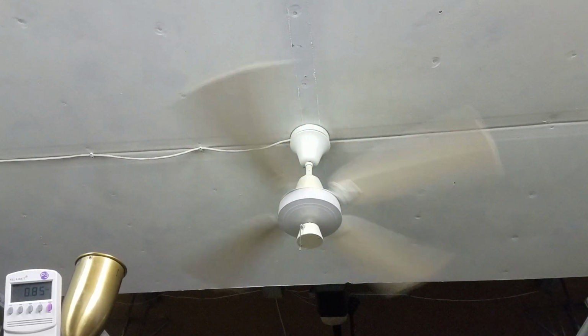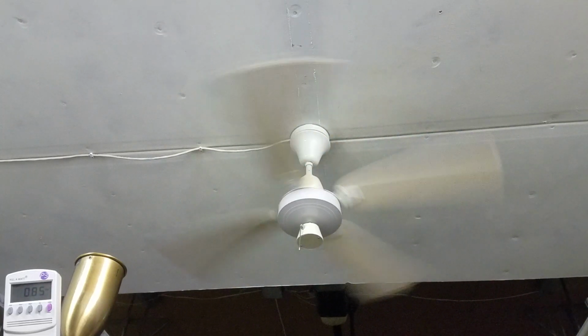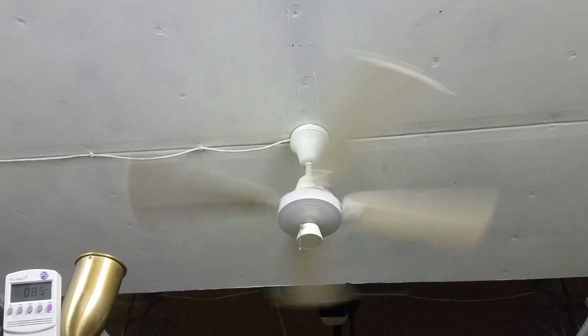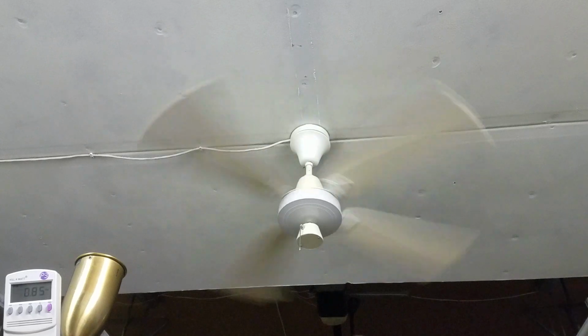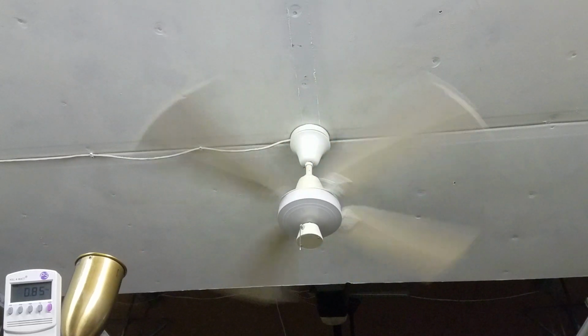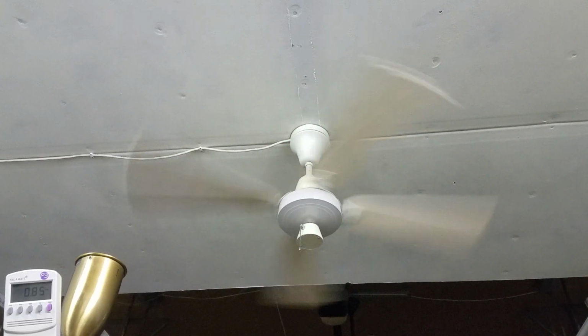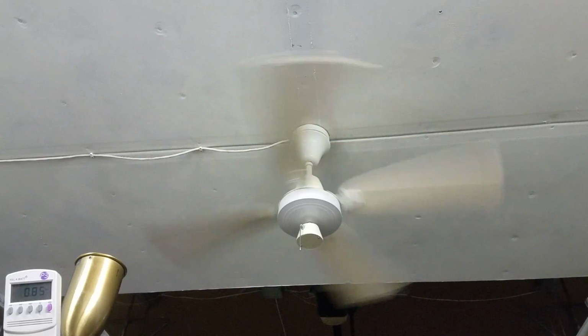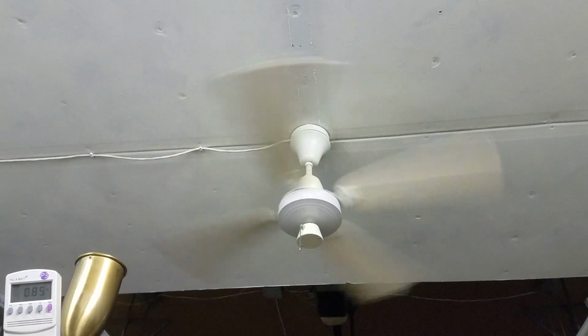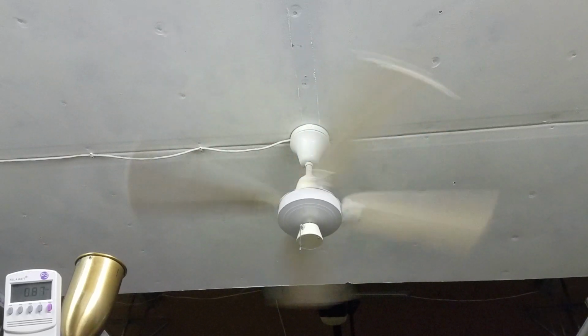With the fan in the kitchen, when I was picking out capacitor values for the control, I've discovered that at least in my house, I don't use a backed off high as much as I would think that I would. I use the slow low for circulation. I use the medium low because my ideal control is always a 5-speed control: you can have an aesthetic low, a genuine low, a solid medium, a backed off high, and a high. 5 is the perfect number of speeds to me. But I found that I almost never use the backed off high.